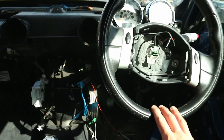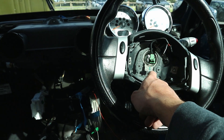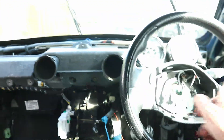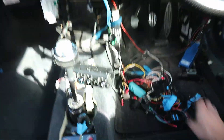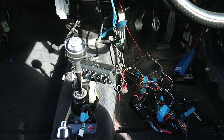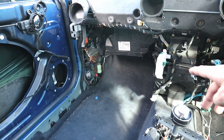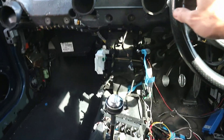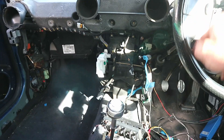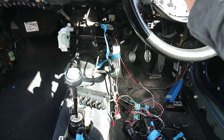I'm going to put the airbag back in for now while it's in the winter because I want to do some on-road testing of everything we're doing to this car. I'm going to put the airbag in so I can get this MOT'd. I'll put door cards on because I've got some from Lowen and we'll be able to get it passed. What we're going to do today is continue to chase this absolute huge pile of wires back. I've put blue around the stuff that I want to get rid of. The art of it is literally just keep chasing it all the way back and remove and unpin them one by one. Good news though - the car has got its permanent home and we're moving it this weekend.